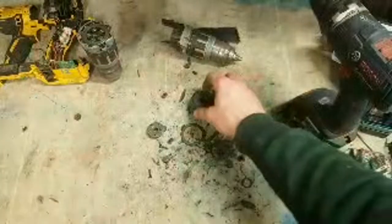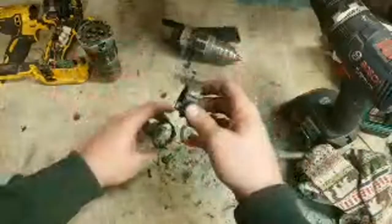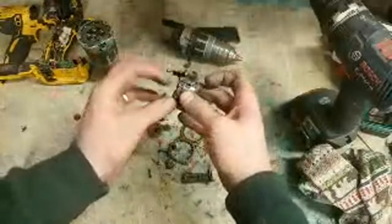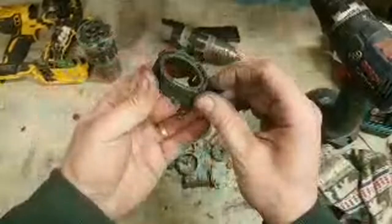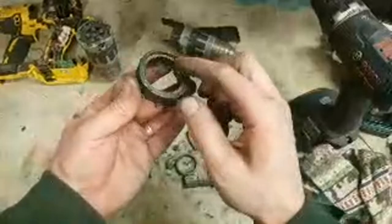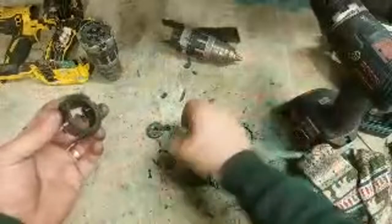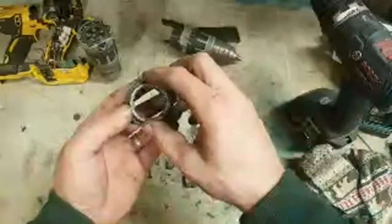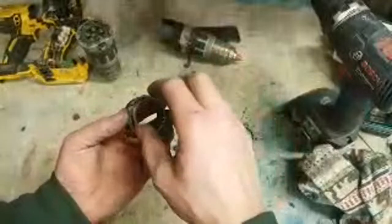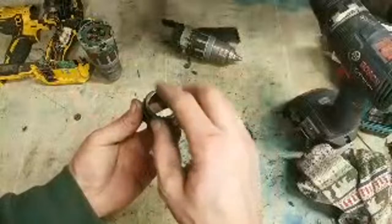That housing's all right. It's the main thing we want to make sure of. For me, why I like DeWalt stuff is actually for that housing there. We can see it now because it's smashed. The plastic teeth down here locate onto this, and that's for selecting one of your speeds. So whenever that gearing is fixed, the gears on the inside run around this, that gives you your second speed. When you start getting one of the gears slipping, normally the second, that's because that gear is not locking on, it's spinning, because the teeth on this plastic housing wear out. It's only DeWalt and Hikoki.